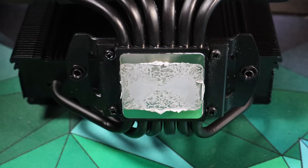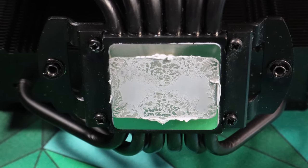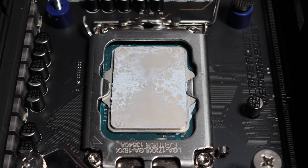There are a few telltale signs you can look out for. One of them is very high temperatures, or temperatures you can't control even by lifting your CPU cooler fan speed. Also, if you remove your cooler and look at the cold plate and the surface of the CPU, you may notice a band of thermal paste across the middle of the CPU, or perhaps even an hourglass pattern. If you look at these images you can see that the thermal paste leaves an impression of the low spot across the middle of the CPU, meaning there's a slight gap that thermal paste is having to bridge when in reality it should be near metal-to-metal contact between the CPU surface and the cold plate.